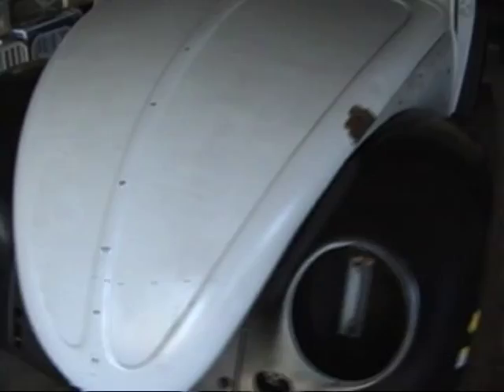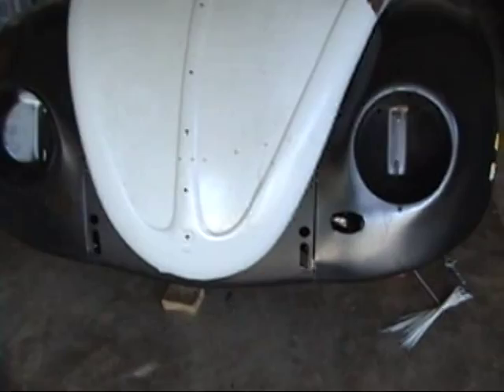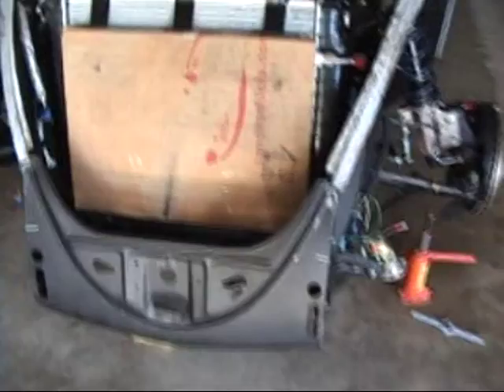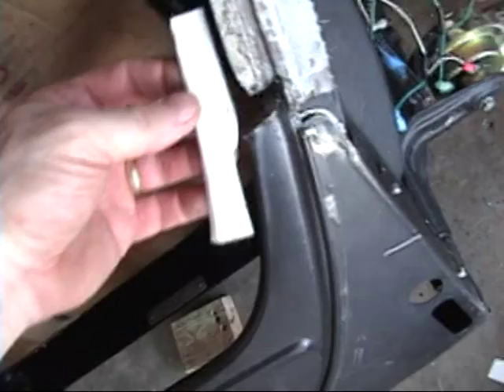Now that I have everything lined up here, I'm going to get in behind this and drill a couple of holes through this flange here. I'll get my little angle drill in there through the flange here and then through the flange up here on both sides and put a little number six screws in there. That'll locate that panel once I take all this apart — it'll go back exactly to where it is. I've gone ahead and pulled the fenders back off and relocated my little holes with these little screws, so I know this is in the right spot. I'm going to have to remove the paint here in order to weld this on. I also have to tie these two pieces together, and I've got a little piece of paper template that I made that's going to go right in here.